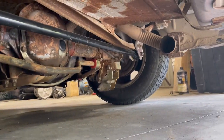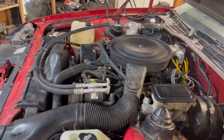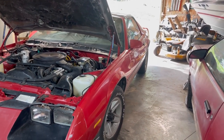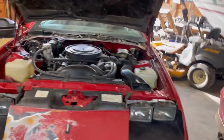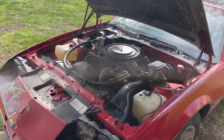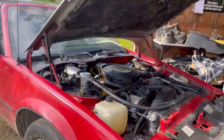Everything is bolted in, sitting on the ground. Got a little bit beefier springs underneath it now — it'll ride a little stiffer, feel more sporty, but it's ready to go for a drive. About to take it out on its first rip with the posi-track rear end. We upgraded to Z28 springs, it has a tubular panhard bar, and better-than-stock shocks. It's going to ride a little stiffer but feel more like a race car. It'll take corners a lot better than that Berlinetta suspension would. Looking real nice, looking like a Z28.